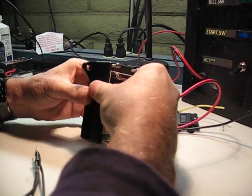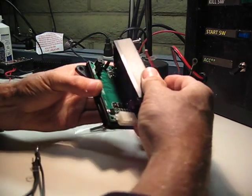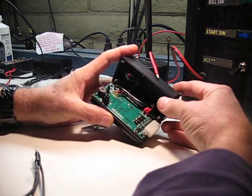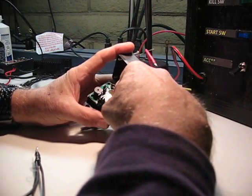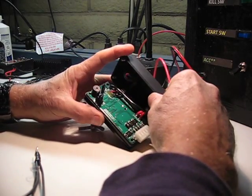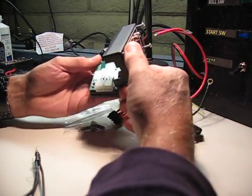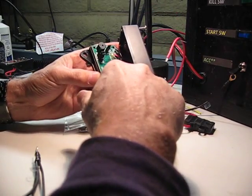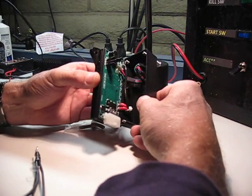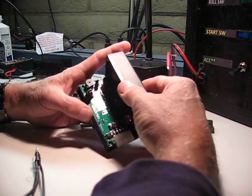When you pull this off, you'll see that the primary wires are coming out the side, and they're directly attached to the PC board that's inside. There's also some nice strain relief on the service loop for the LEDs. Generally, this is about as far as you need to take it off. The grommet hole is slotted, so you can get that off, but just be careful about ripping the wires. There are 4 wires for the LED, and they're relatively robust. But really, there's no reason to go on beyond this.